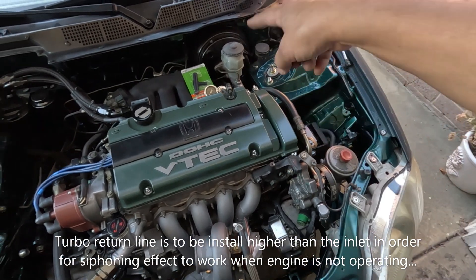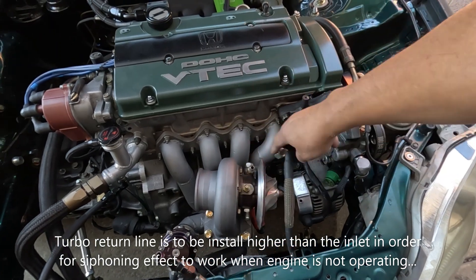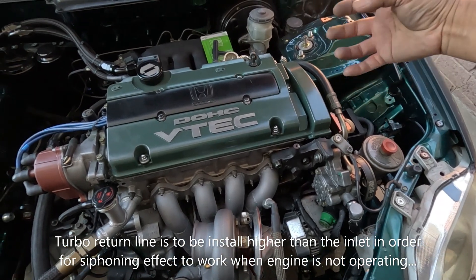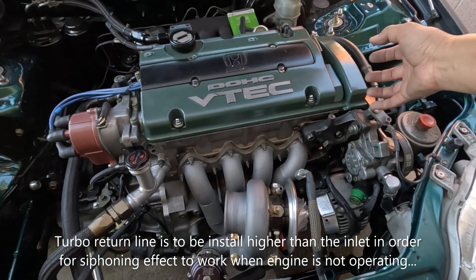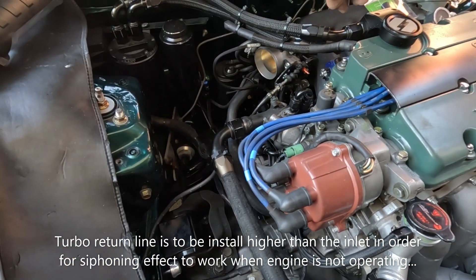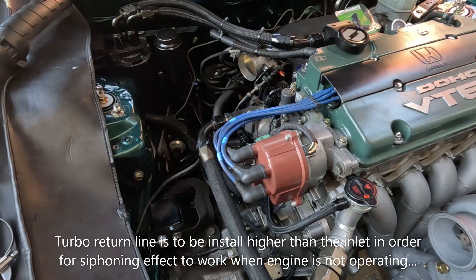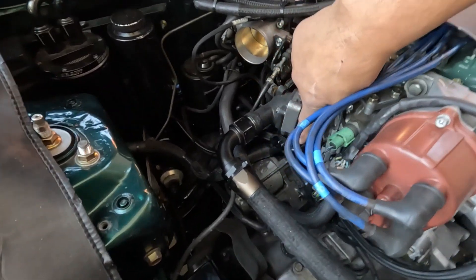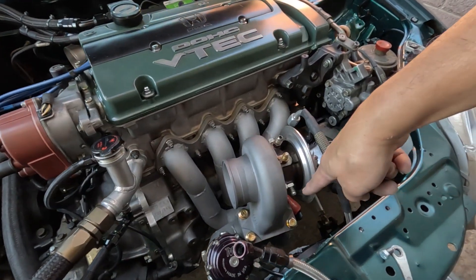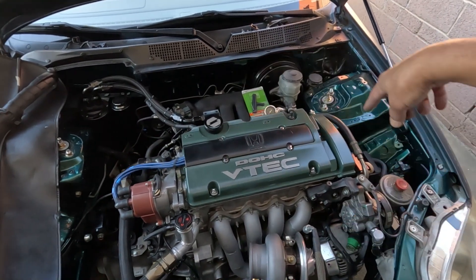You're probably wondering why not run cold water directly into the turbocharger and out the other way — just reverse it. Remember, when the engine is running, it pumps water out through the IACV and flows back into the cold side. Since pressure is coming from that port and shared, it pumps through and goes out back to the cold side — that's how the system works.